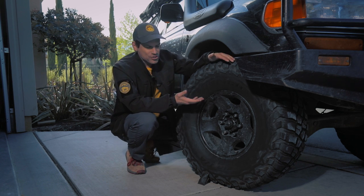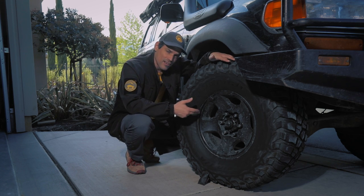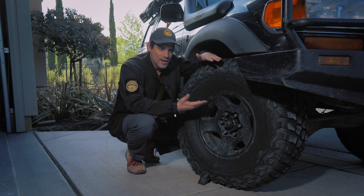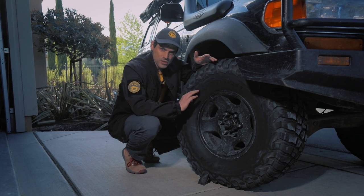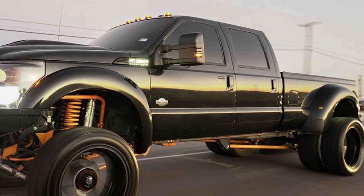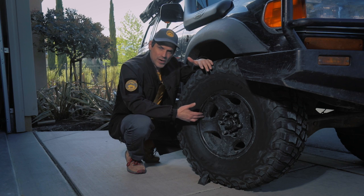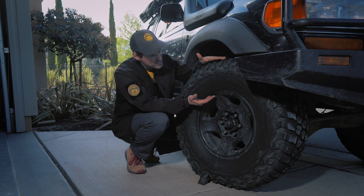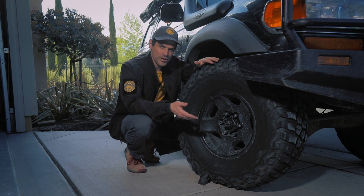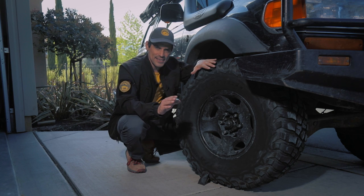You can see that I have a large sidewall — this is a 16-inch rim, and I've got 315/75R16 tires on here. When you're going to be off-road, you do want a deep sidewall. If you see those big wheels with just a little rubber band of rubber around them, you wouldn't want to take that off-road because you don't have the sidewall necessary — you're going to damage your rim, it's dangerous. So the first thing is that you want a nice sidewall, and the other thing is how heavy are you? Those are all going to determine how much you should air down.